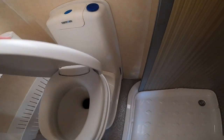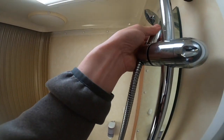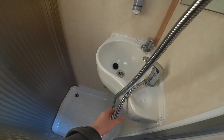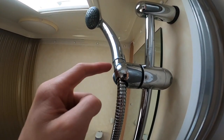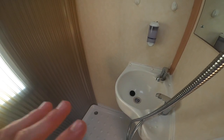You just have to keep an eye on the cassette to see when it is full. You've got your shower screen, which you can push along and it will shut the toilet off from the shower. When winterizing, it's very important that you remove your shower head from your hose. It's got a loop and any water that could coil up there could potentially freeze and split the pipe. So unscrew it, lie the hose into the tray and leave all the mixer taps open. Any water in the pipe lines behind the taps will just go straight out of the waste, which would be open outside, as would the fresh water. So all the water would just drain out of the vehicle and there's no chance of it freezing in any pipe work within the motorhome.